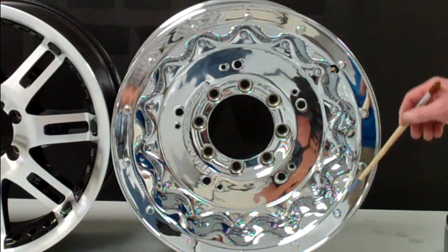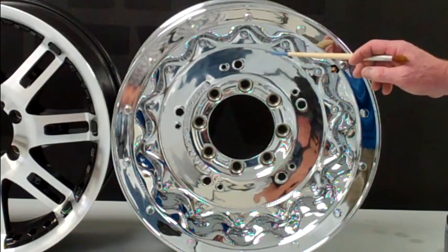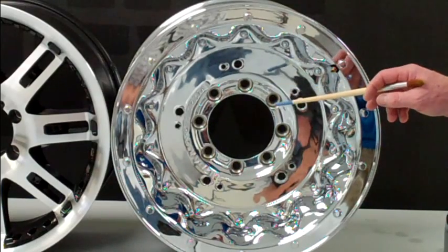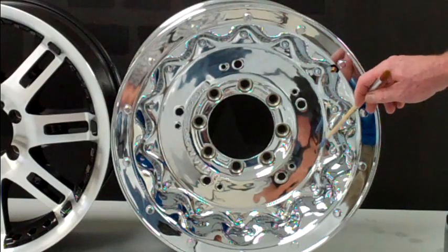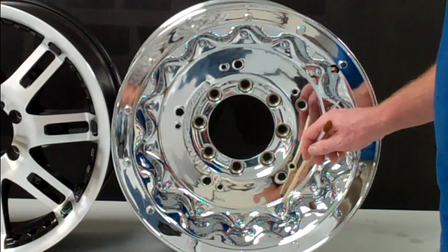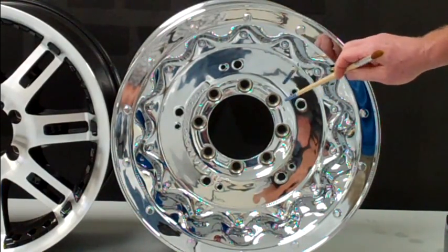On a chrome wheel like this, if you're detailing your car and it's a fairly soiled wheel, you'll begin your cleanup with a fairly caustic cleaner to break the brake dust down, followed by soap and water, then a chamois, and perhaps even window cleaner so that you don't leave any water spots. When we apply Wipe New, it becomes literally just a soap-and-water wash, wipe it off with a chamois — it will not water-spot. You may have to chase a little residual water out of small areas, but it just takes your time factor down to a minuscule amount compared to a regular cleanup.